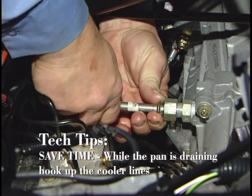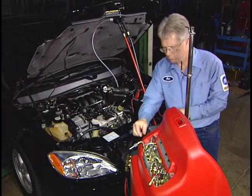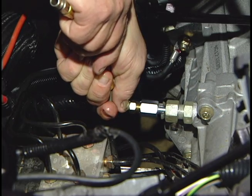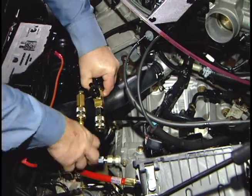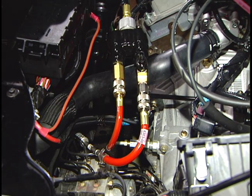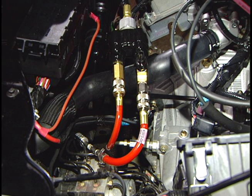Disconnect the cooler lines and attach adapters to the input and output connectors. These hoses may be open hoses and/or snap or threaded fittings. Attach the adapters to the unit's cooler line selector valve assembly. Note, the adapters can be connected to either coupler. The selector valve assembly ensures the correct fluid flow. The 92-500 will not let you hook the lines up incorrectly.